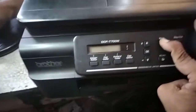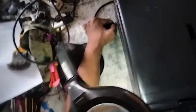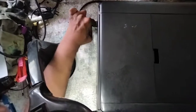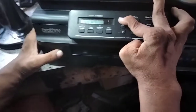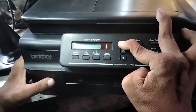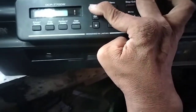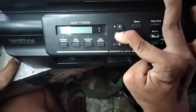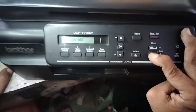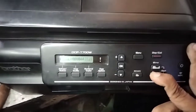Remove the button then insert the plug. Maintenance will appear on screen. Release the button, then press arrow up. Enter 8, then OK, then 0, then press OK. Search for the parts counter.